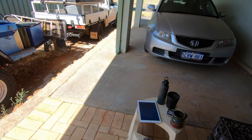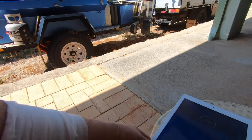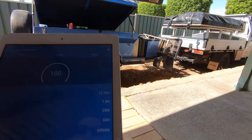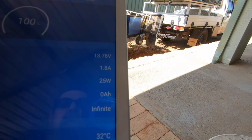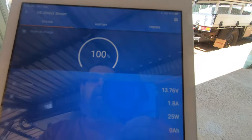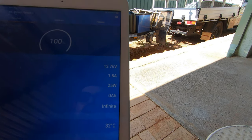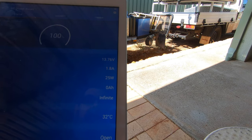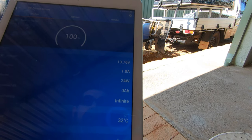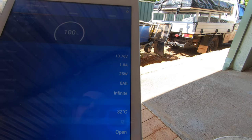This is the last bit of the video. I've been sitting here checking temperatures. I've got no hot spots or anything in there. The batteries right now are plugged in, and it's also plugged into the car. The current's 1.8 amps. But the actual current coming out of the solar panel is nothing - the batteries are full. That 1.8 amp is probably going into the car, because every amp that goes through that solar panel, either into the car or into the trailer, is counted.